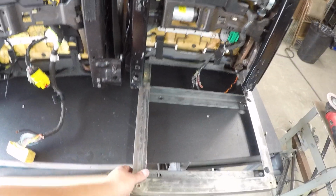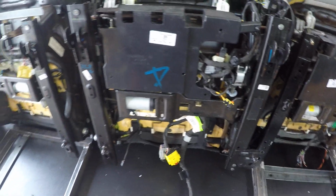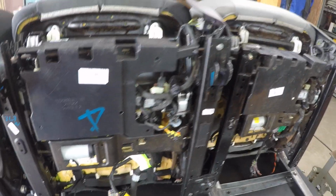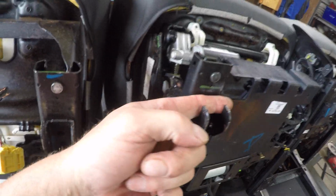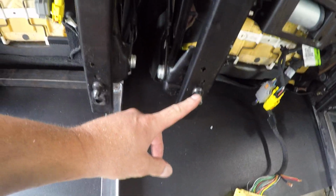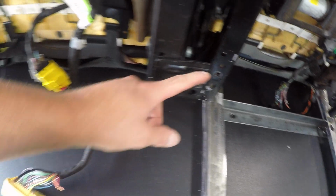There's a few things we need to do to these seats though to make them work with these brackets. All these GM seats are going to have specific mounting points on the factory seat already. You're going to have these big monster hooks right here. These seats were factory mounted with just 2 bolts originally, and they had 2 mounting points, one right here and one right here in the back. And then they used this hook system up here that went into the floorboard and caught it here, and then you've got some locating pins over here and here as well.